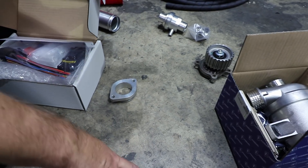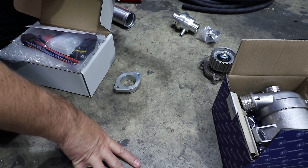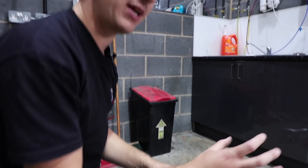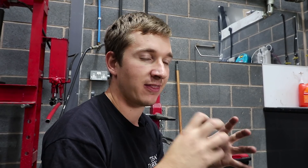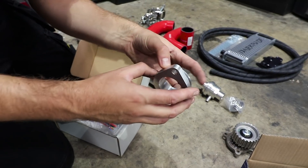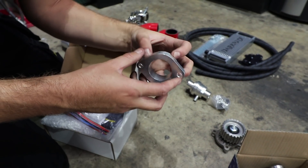Because on this oval port engine, you're putting the water pump before the engine as such. Normally when it's in the engine on the timing belt, the thermostat's in front of it and the hot circuit goes around - we'll try and put a diagram up of what the hot circuit's like. The hot circuit is behind the thermostat, so when the hot circuit's going around, that opens the thermostat and away you go. If you're putting the water pump to the other side, you're pushing in against the thermostat - you can't do that, because it's never going to open, and you're going to kill your water pump.